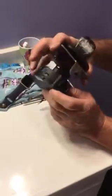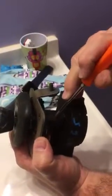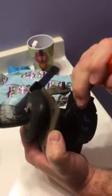To get this out, the key won't come out right now because there's no battery power to the switch — the connector plugs in here. To get this out, you have to turn it to the first line, not crank but the first line right there. Then you're gonna take a little pick and push this little pin right here. If the key is in any position besides that first line, this pin will not push down.